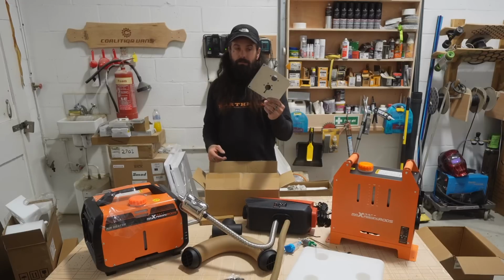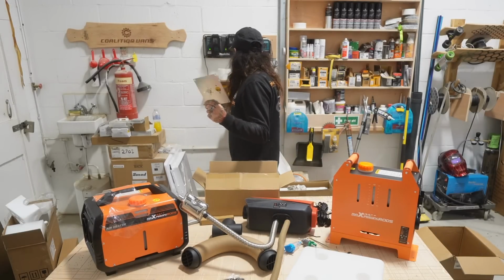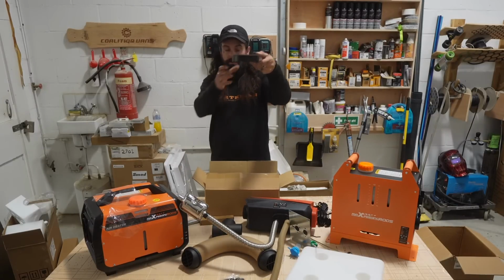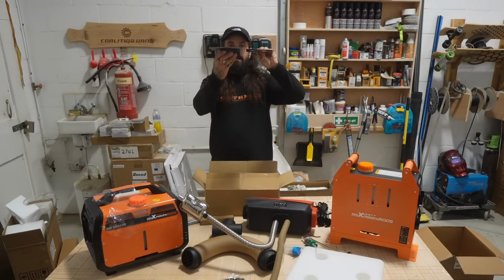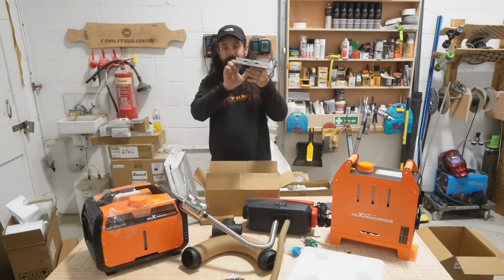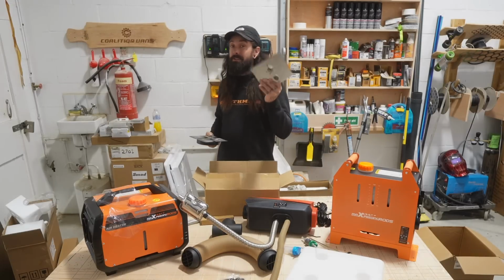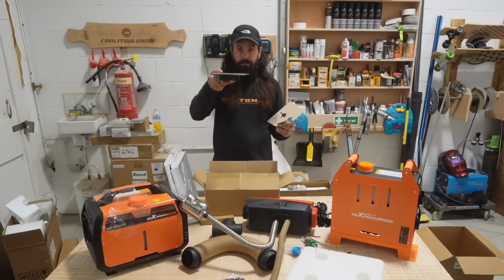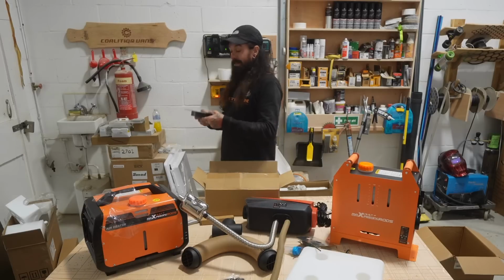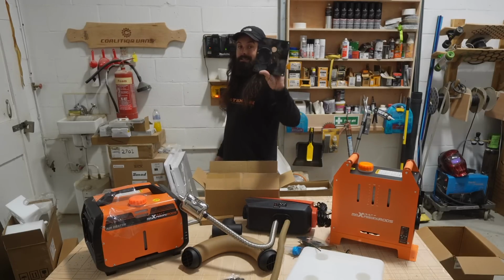Again, I've told them not to bother putting these plates in, and you can use these plates, but there is a better option, and I just happen to have one behind me. This is a turret plate, it's got this bit on it, as you can see there. And that means that you can drill one big hole and that will sit inside and form a seal so that even less exhaust gases can get through. I've used these before, they're all right, but I much prefer this option. Get these on Amazon and eBay. If you just search diesel heater turret plate, that's what they are for.